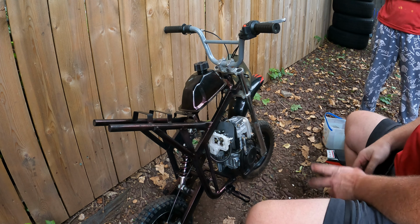I wanted to make sure this thing is completely cooked. Any sugar that was in there is out of there. I'm glad I boiled this directly, because it was definitely getting out other stuff. Before, I just put it in hot boiling water. I didn't actually let it boil. And I was worried I wasn't getting these orifices cleaned all the way. And without the spring there, this is collapsed and doesn't let enough fuel in.